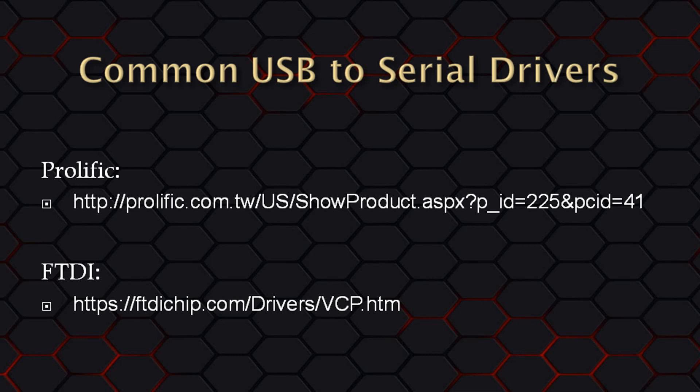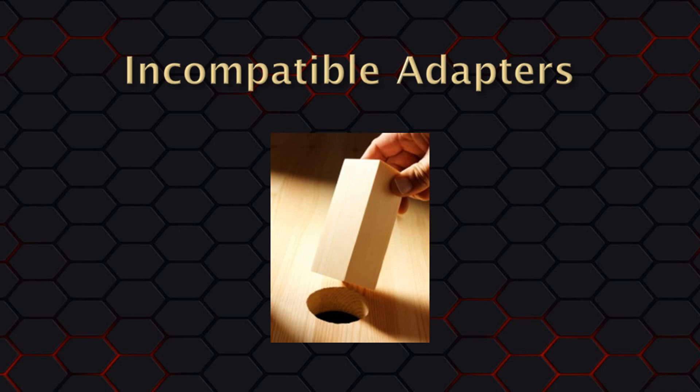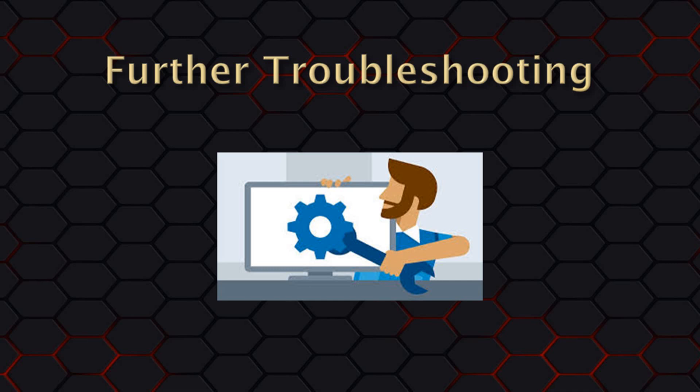Here are the web addresses that you can try — these links will also be down in the description for this video. If all else fails to get your adapter working with your computer, then the adapter just may not be compatible. In that case, you will need to purchase a different USB to serial adapter. We do offer USB to serial adapters on our website if you need a new one. So, we covered how to verify that you have the drivers installed for your USB to serial adapter or USB timer on a Windows computer. If you are able to get the drivers successfully installed but still have a communications issue, proceed to our next video on communications troubleshooting where we cover some tests to determine where your communications problem lies. Check down in the description for the link to the next troubleshooting video.